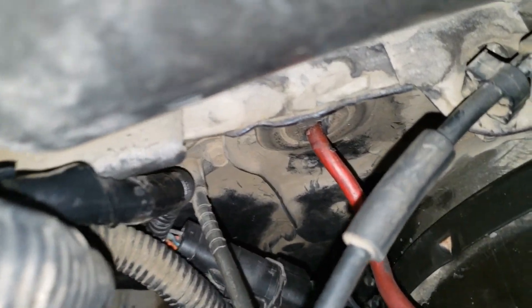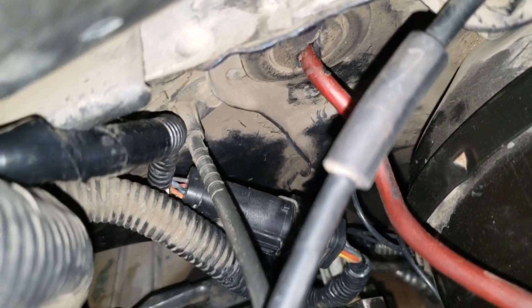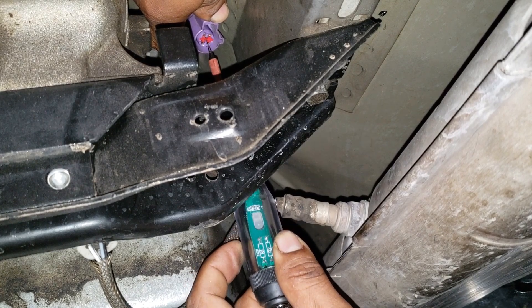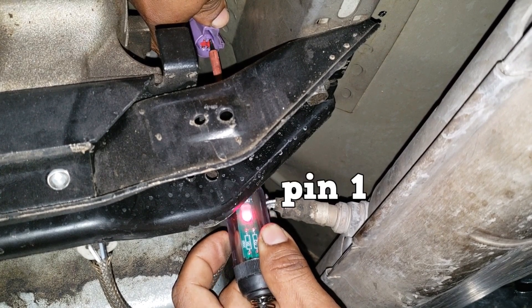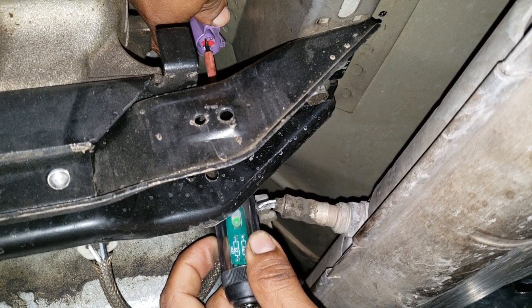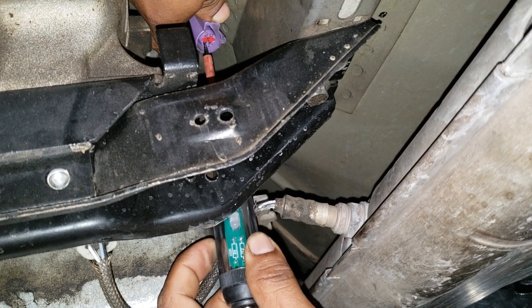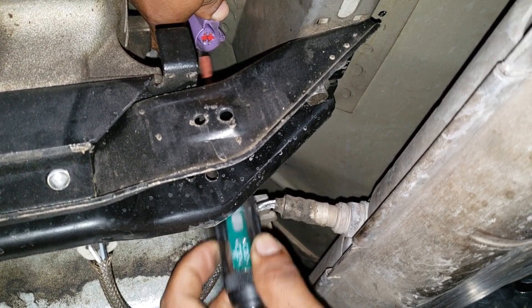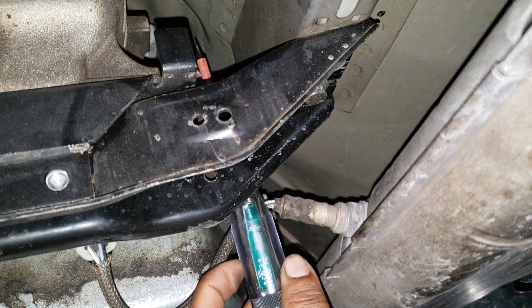I did not have to drop the transmission in order to plug and bond the original connectors. Now we retest the female side of the oxygen sensor's connector. While the engine is running, pin number 2 now lights up as ground — the circuit has been fixed. Same with the sensor on bank 2. Remember that pin 4 is for the voltage-generating circuit and will never show any activity on the female side of the connector. After a few days, no diagnostic trouble codes are stored. Subscribe for more Mustang content, and have a good day.